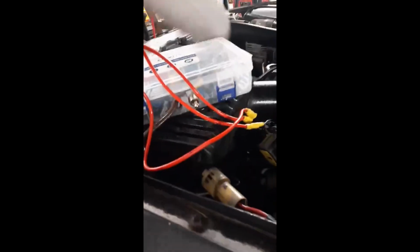Did not see a dramatic increase in the feel of the pedal. So what I'm going to do now is I'm going to put the motor leads inside a rubber glove, turn it on. I'm just going to bleed it cycling the solenoids. Now she's starting to feel hard. The next wheel. And we have a light. Wow. Big difference.